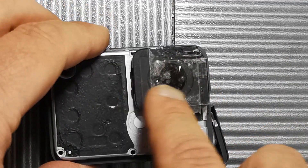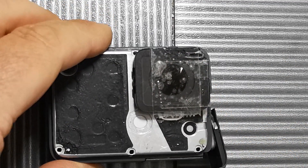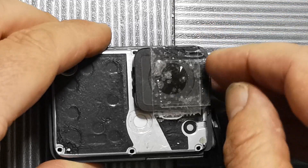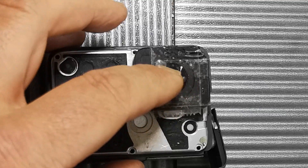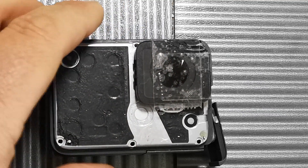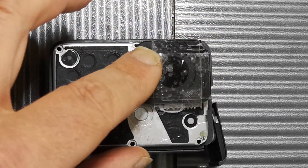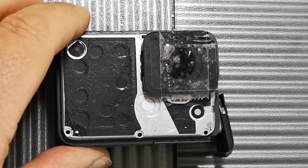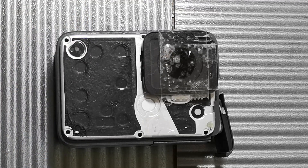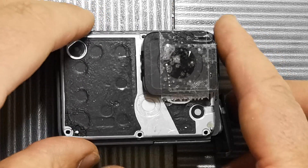The reason I've got tape all over the glass here is because I was originally trying to file this off with a file, and I ended up putting a couple of cracks in the glass which hopefully aren't visible from the lens. So put tape over the glass first before doing any grinding or filing — there's a better chance you won't end up cracking the glass, because that's just going to ruin the camera.